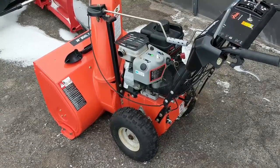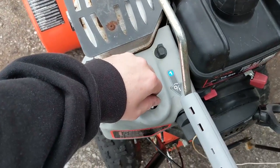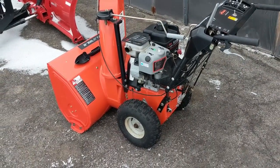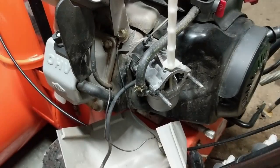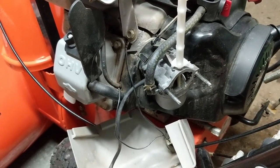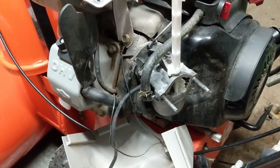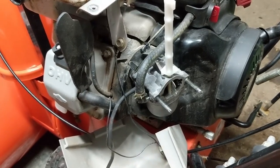It's surging - you can hear how it's revving like this. With the choke slightly on, the idle smooths out, so that means we've got to richen it up more. When the carburetor was running with the choke off it was surging, revs going erratic up and down. When we turn the choke on slightly - two clicks - it limits the amount of air going in, richening the fuel mixture and creating more suction throughout the carburetor. So I'm going to fool around with this a little bit more to take care of that surging.